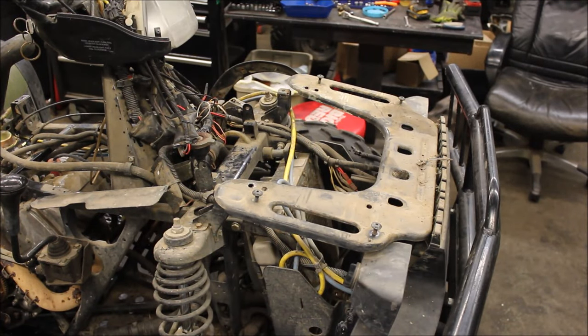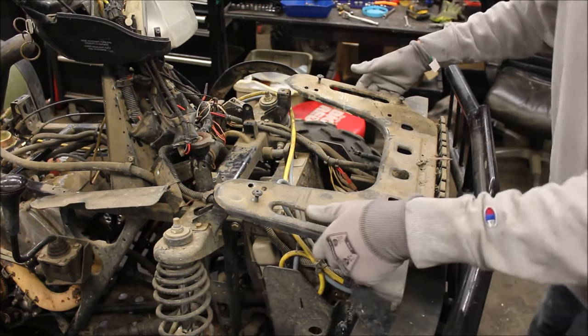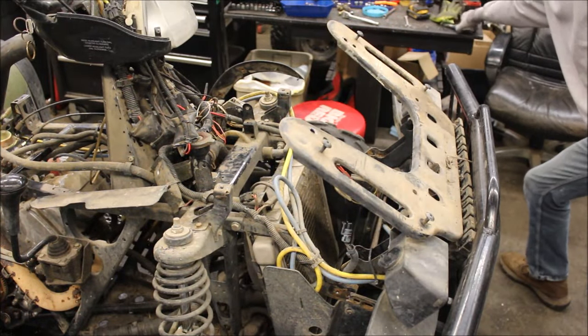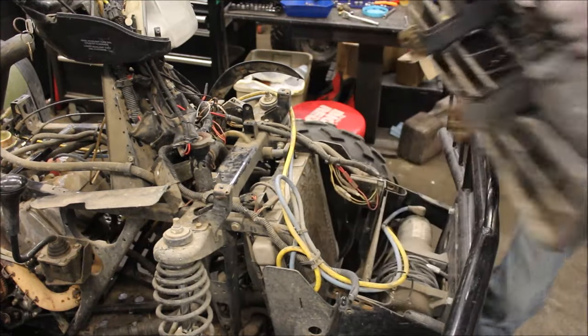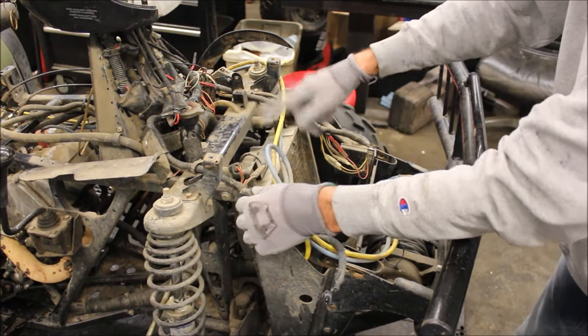Alright guys, let's go on to the last step. I'm going to remove the radiator. But before I do that, I'm going to test the fan — I want to make sure the fan is operational before I go through all the trouble of replacing the radiator, put it all back together, and find out the fan doesn't work. So make sure you disconnect your headlights. I got this all unbolted already, so you should just pull it out. You have your wire right here that goes to your main harness, to your fan.